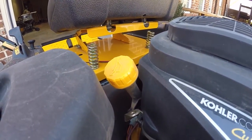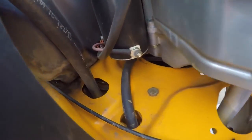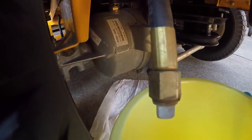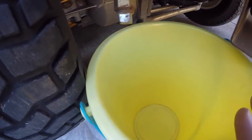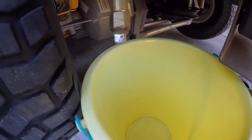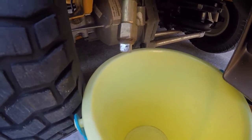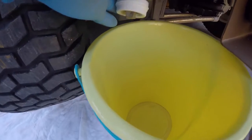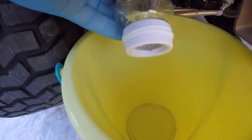The next thing we need to do is change the oil. I can see my dipstick here, but I haven't changed the oil in the last season and a half. My particular model has a hose that comes down from the engine itself and down under the mower right here. All I have to do is remove the nut on the end of this and drain it into an oil-safe container. I'm using a kids' play bucket — the oil is warm but not hot. Another trick: if your hose is not long enough, you can use a creamer bottle with the spout cut off to guide oil into your container of choice. I'm going to use two pairs of vice grips to remove the nut on my oil drain hose.